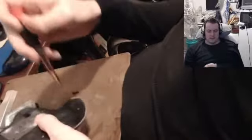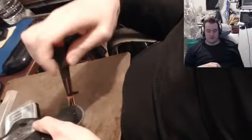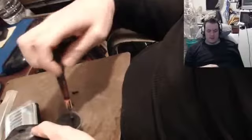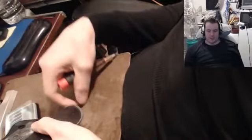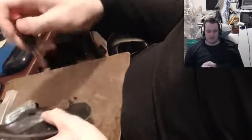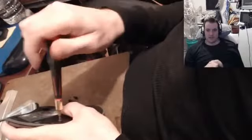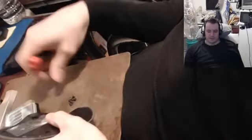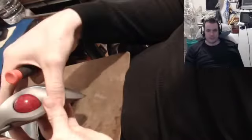has a little tiny copper spring inside of it. And if that spring has no tension, it will just randomly think you're clicking because the button will be depressed all the time. It won't ever come back up. Or if you click it down, it might think it came back up or think it's clicking down again and again. It needs to be all the way up or all the way down, so the spring determines that. That was my problem. My spring got flattened out.